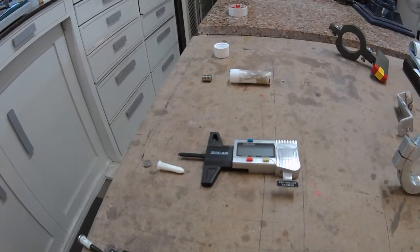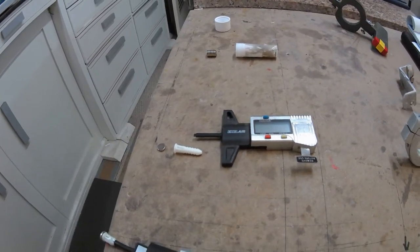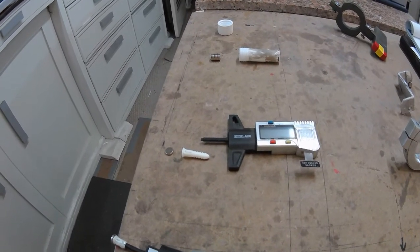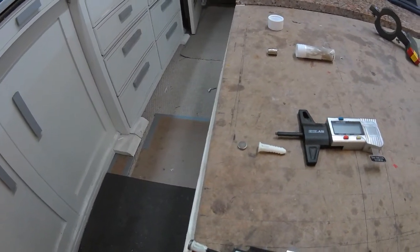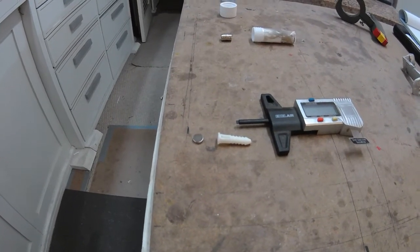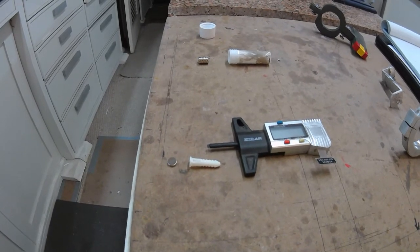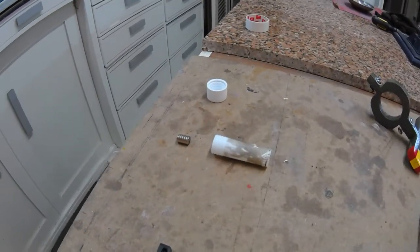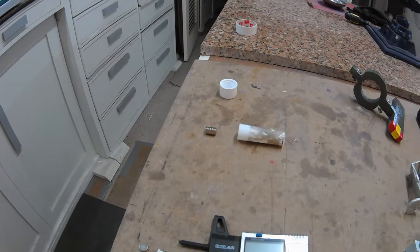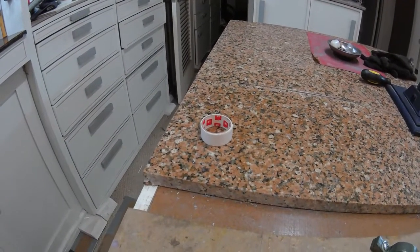The digital tire depth gauges are sold on eBay. They come with plastic horns — I simply remove that and attach the rare earth magnet with a drywall anchor screw that I cut in half and then reamed out to four millimeters for the probe. The rare earth magnets are from Harbor Freight, about three bucks for ten of them, and the double stick tape is also Harbor Freight.